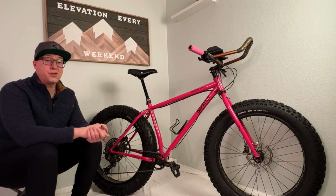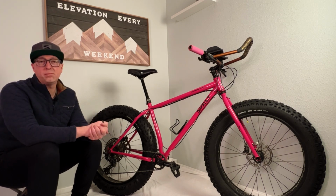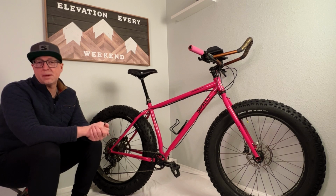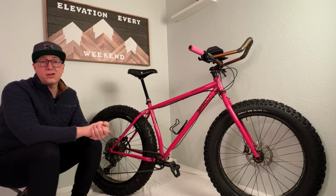I've also had issues, especially over the last year, with the rear tire being prone to burping air when aired down, and that would happen if I braked a little too hard or if I maybe hit a frozen rut that deformed the tire a little bit too much. Obviously, the rear is going to be more prone to that just because you have more of your weight on it, but again, this isn't really an issue I noticed at all in the first year and a half of running that tire, so it has definitely appeared to get worse, and it could be in conjunction with the sidewalls leaking more sealant and losing air gradually during the ride. It's probably made that a more significant issue.